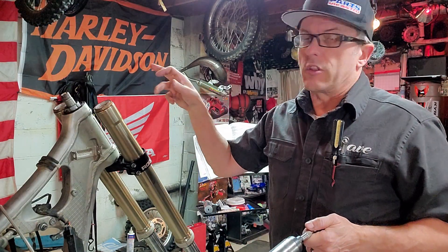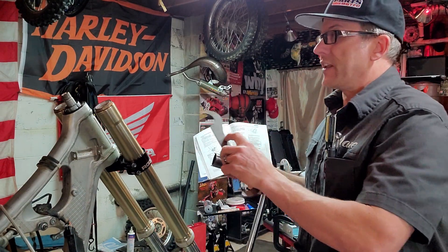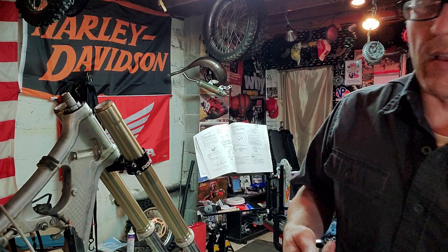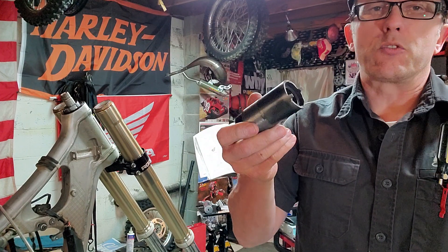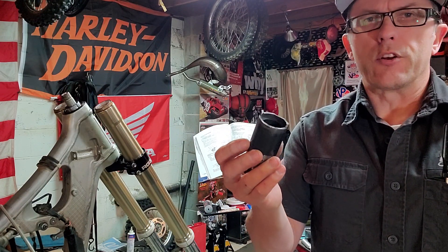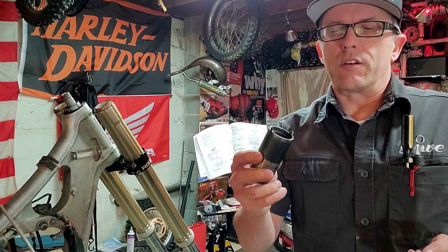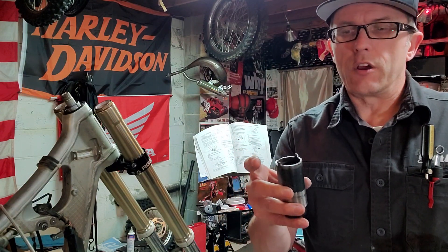They make tools — little hook tools that have a slot in them for your torque wrench to fit in — because you're going to need to be able to turn this properly. You might need a little hook tool like this that has a slot for your torque wrench to fit. If you don't have one of those, you might have to create something, or you can buy tools like this. They're very expensive sometimes. It's going to be roughly 36 millimeters inner diameter. Or you might have to just create something, quite honestly.